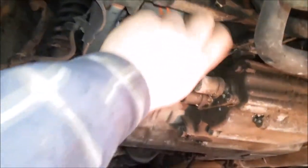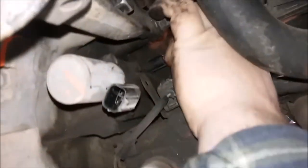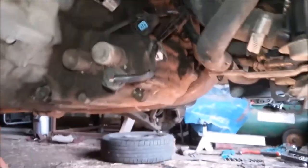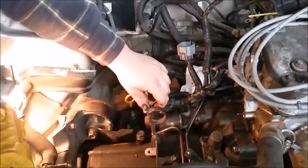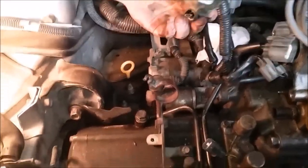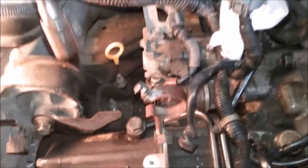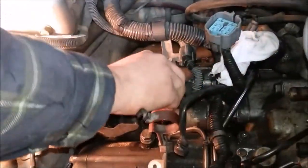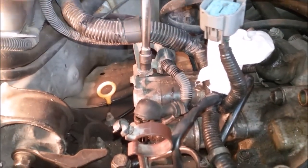The wires you need to take off are underneath — there's one right here and one right above it. Those should just pull up through the top so you can get them out of the way. After you pull the wires out, there's a connection to the starter. One connector should just pop out — it's a small connector. The other one you'll need a 12mm socket to remove: just loosen the nut enough to take it off. Then use a wrench to take the bracket off since it's attached to the starter.